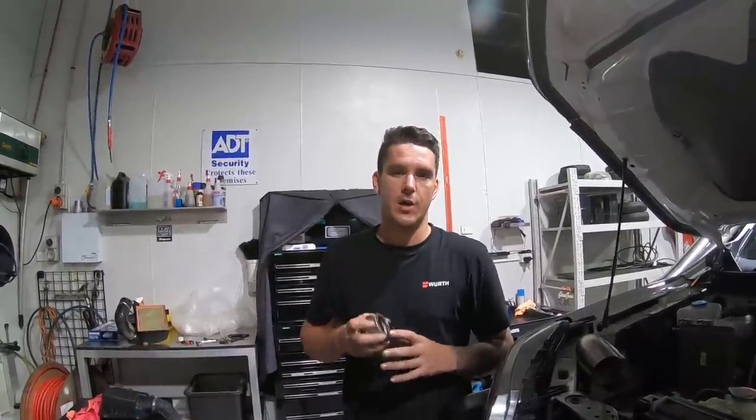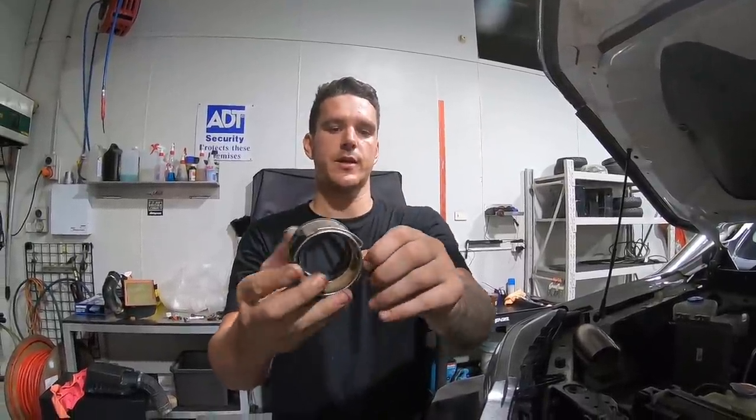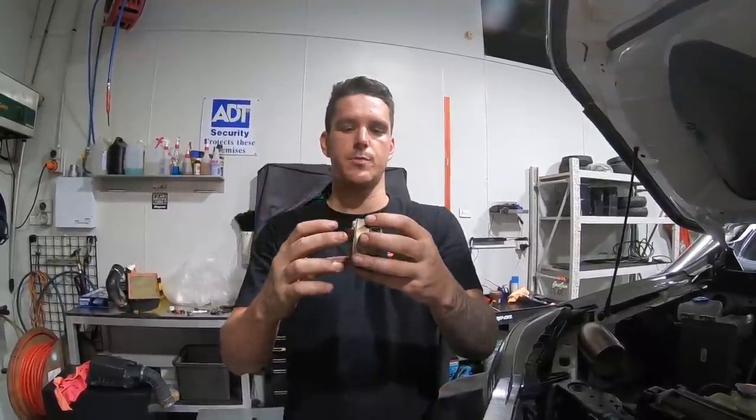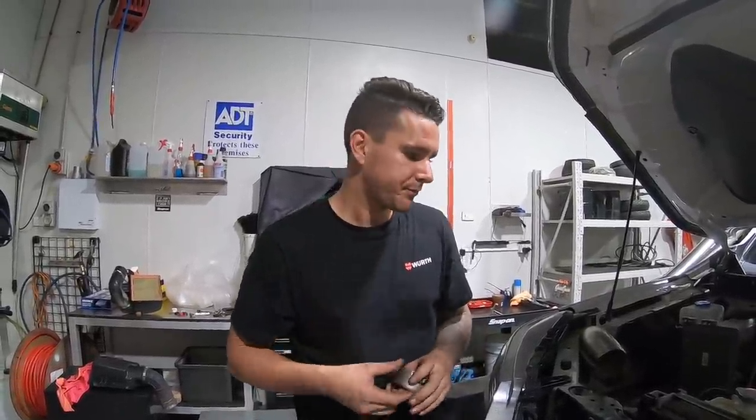Alright guys, so it's actually 2 days later, believe it or not, and on Saturday night we hit a pretty big snag. I couldn't actually get the last piece, which was just the hot side, to connect to the hot pipe. That's basically because of these fittings that we did show earlier on in the video. They're just like a clip lock fitting, and because it had that on it and it's a 2-inch pipe, I couldn't fit the coupler over and clamp it. It just kept blowing off, so that was no good.